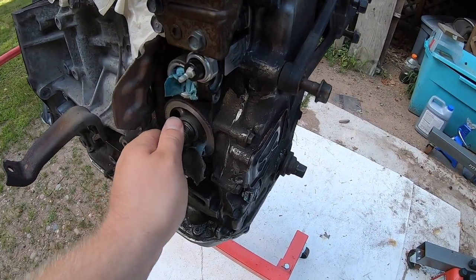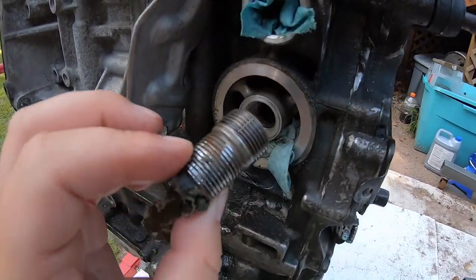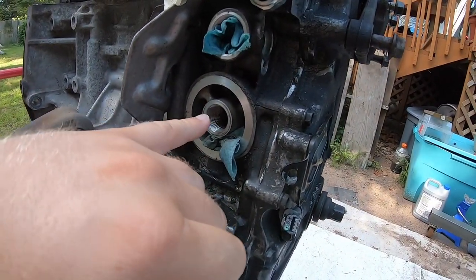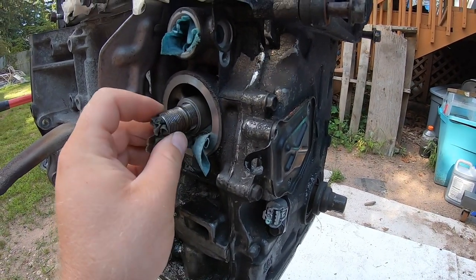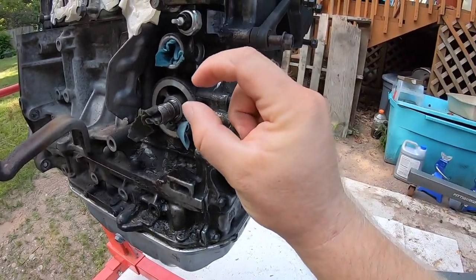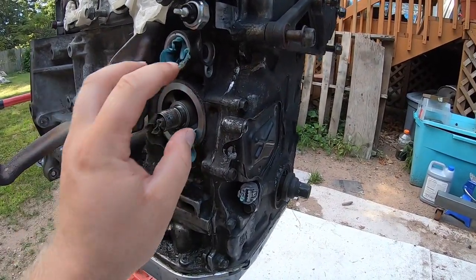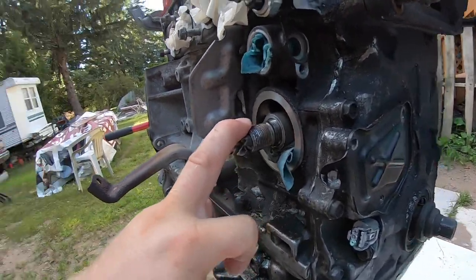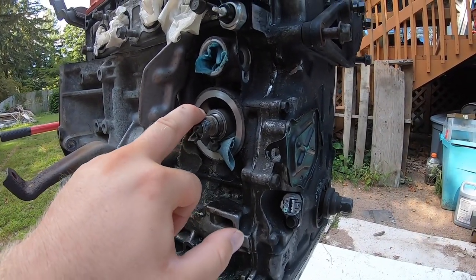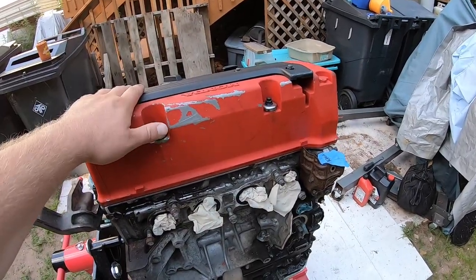Along with your oil cooler — a lot of people ask me this question and a lot of you guys don't really know this — but the Z3 comes from the factory with an oil cooler. When you take your oil filter off and remove the big stud, flush against that surface is an oil cooler where your coolant and your oil are basically regulated. It travels with a hose to the water pump housing. Use your Z3 oil cooler. It's not mandatory, but if you're going to be racing and driving your K24 hard, this mechanism is probably going to help with higher revs.